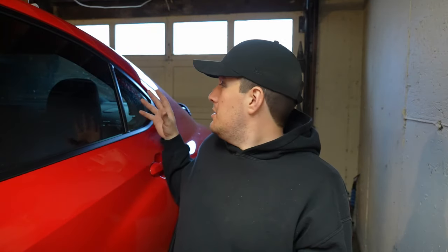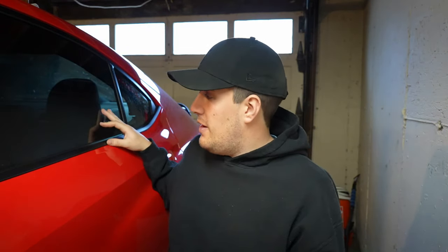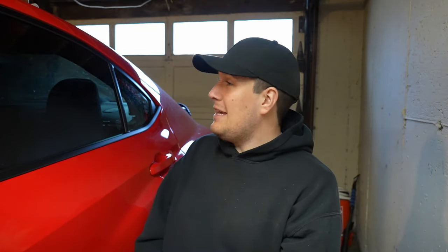It will come out over time. If you go to a tint shop, they will tell you it takes almost two to three weeks of sunlight and some long-term heat to get that liquid out. And that's the reality. After doing this window, I would say this is probably one of the better windows I've done - I don't see any imperfections. I would say this is probably a shop-grade installation. From an installation standpoint, it's pretty good. There's nothing noticeable wrong with it. It takes two or three weeks for those little bubbles of water and air to get out. The film is designed for it to come out over time with UV rays, heat, and sunlight.